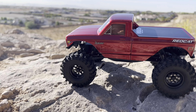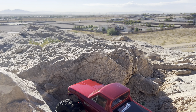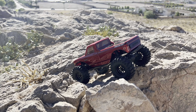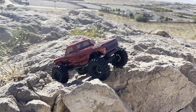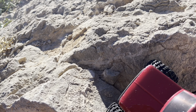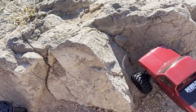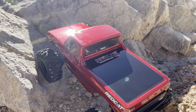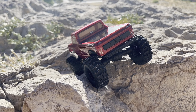Right off the bat, the lower-range gears feel pretty good. There's a first obstacle coming up here. I can see the larger tires make the approach angle much nicer. It got over a lot easier. These are larger, softer compound S5 compound tires — the Endura Swamp Stompers 64-millimeter. I was actually able to take this line right here where I straddled both sides of the V, whereas last time with the smaller harder-compound RC 4-wheel drive tires I had to kind of work side to side. But with the larger tires and the brass portals up front, I'm able to cruise right over this. That is nice.